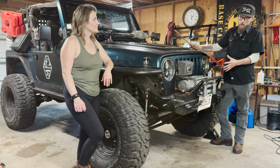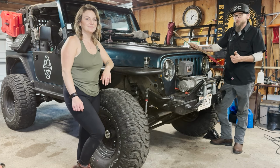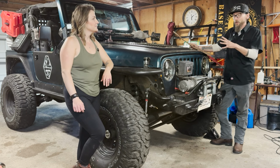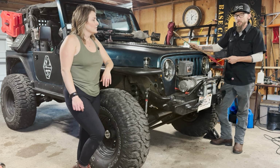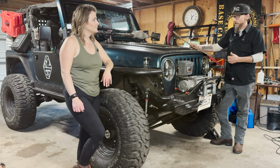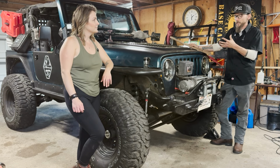We've got brand spanking new Milestar tires on here, and a new set of springs from Clayton Offroad. So that'll hopefully stiffen up our ride and help with all the weight we've got going on. Also threw in a rear track bar from Clayton as well, to keep things straight and square in the back. New Johnny joints from Rock Jock should square up and improve our ride from those Heim joints that we were oscillating so much.